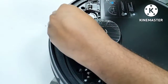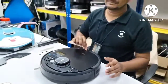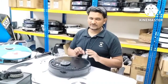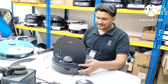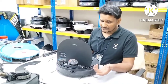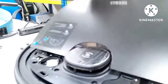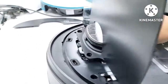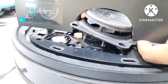I just want to show you that if the LDS is totally not turning, there might be something wrong — the belt is stuck or the belt is broken. If the belt is broken, you can replace it if you can find the same belt or the service center can provide you the belt. There are four screws — I already removed them. Now we can take out this cover. This cover is slightly — we can just pull it up a little bit and remove it from here.